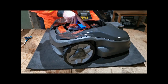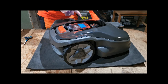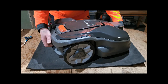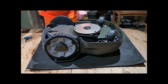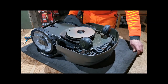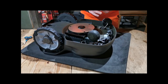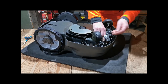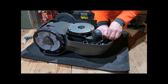Before I dismantle everything here, we're going to turn the mower off at the power switch. The mower is shutting down - good news. Close the hatch and spin it upside down. Remove the power cable. And always put a little blanking plug on here to stop any grass getting inside while we're working on it. Then disconnect the cable.